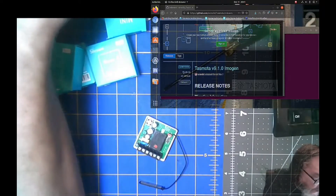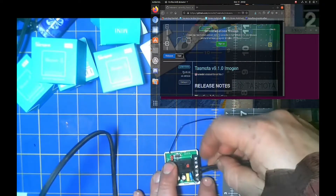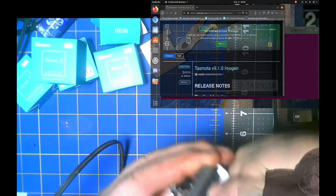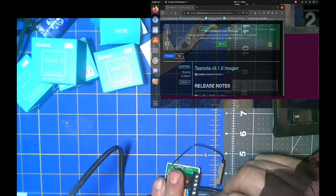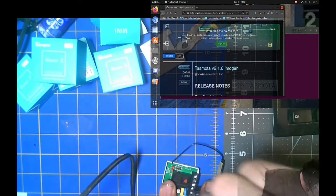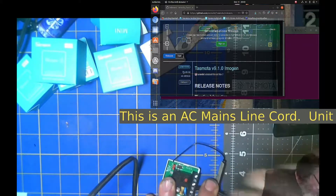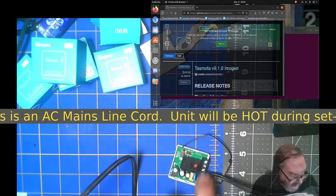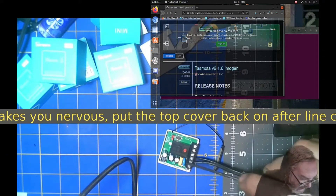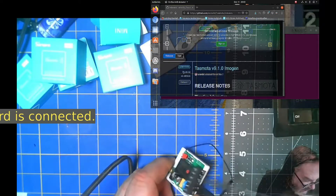Here we've got the power wire. These have to be loosened. Those go in there and you push them in all the way. Make sure there's no strands sticking out — strands hanging out there wouldn't be good. Now we're gonna need to be careful with this. Touching here — you gotta kind of sink in to touch it — but that's AC mains right there. Don't touch that. There could be AC mains here and here. Don't touch that.